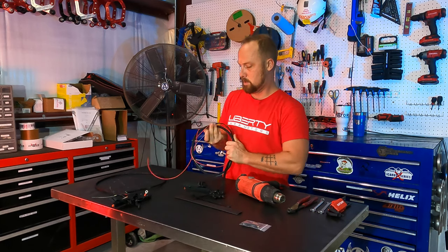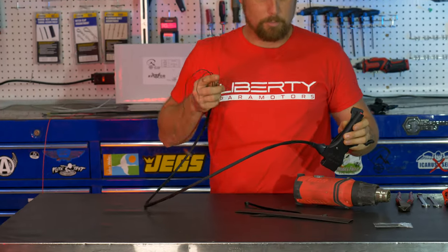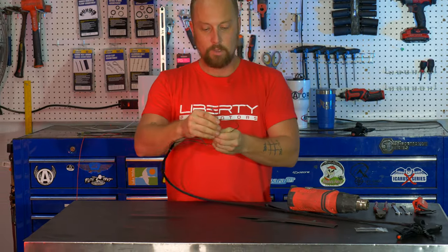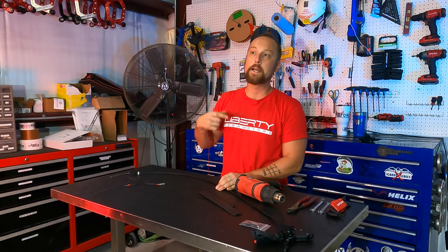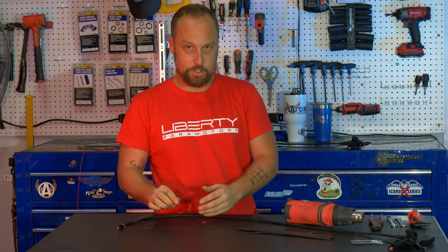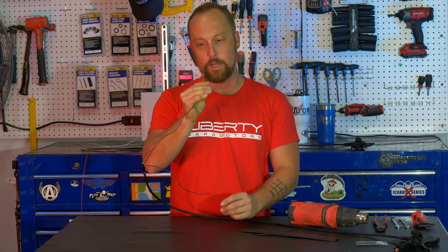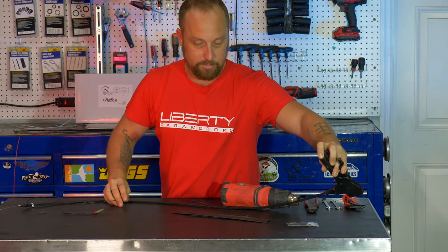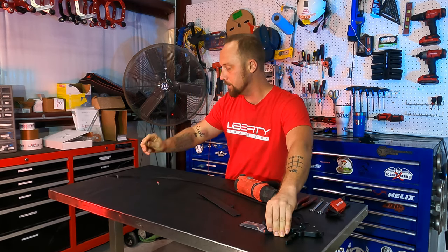The off-grid throttle has just one wire which serves as the kill switch function. The way the kill switch works is the flywheel itself has a magnet inside it, and as it's spinning around it's creating energy into that coil, and the coil is providing spark to the spark plug. All the kill switch does is send ground from the crankcase itself with this ring terminal, through this wire all the way up to the kill switch, and when you depress it, it completes that circuit and sends that ground all the way down to the coil, which kills the energy in the coil.